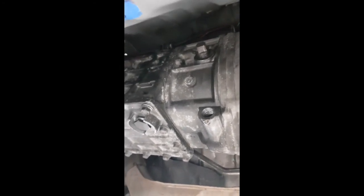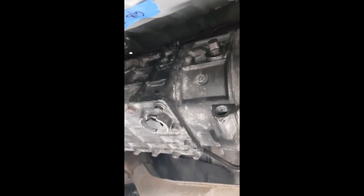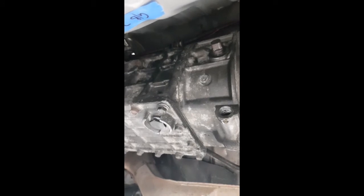So I'll put the bottom secondary drain plug back in, torque them up, and then I'll pump in the same method as I did on the diff, measured to 2.5 litres. Right guys, so you'll see there that that's the secondary drain plug that I've used to put back in. I put some sealant tape around it. I've put some more WD on that one. Just leave it for a while. So that's both the bottom drain plugs in, and that's the gearbox done.